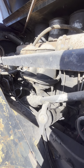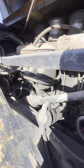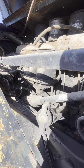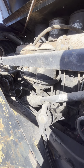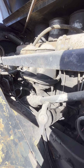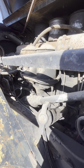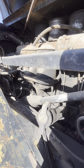Here's your air heater that we talked about on the block up there — this is optional, you don't often see this. You can see it says 'Air Heater — Used While Cranking Only.' This is the switch that lights your glow plug. So what you do is turn on your ignition to get power, turn on that switch for the glow plug, and then as you're pumping this fuel pump that goes right to your tank and squirts fuel into the air box, you press your starter switch as you're cranking until it fires. So it's actually burning fuel inside the air box to get hot air. That's really important for a diesel on a cold day — you can't get that air hot enough just by compression alone, you're not going to start. That's why a lot of guys have never shut them off — they just leave them running.